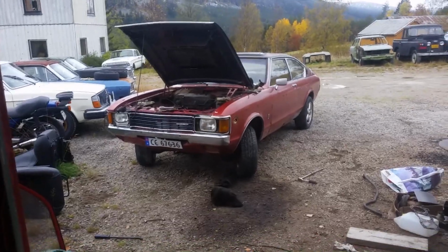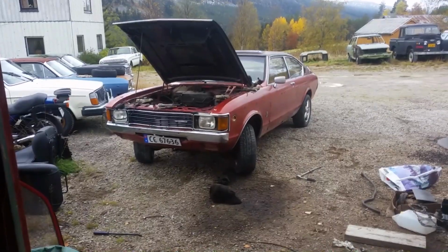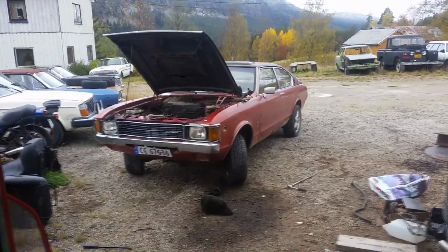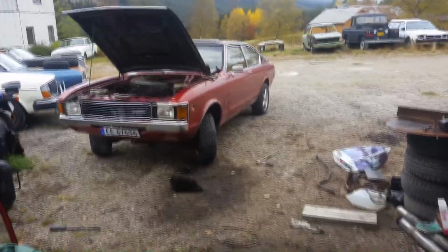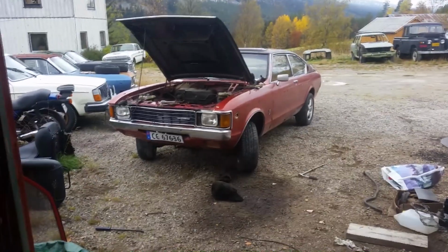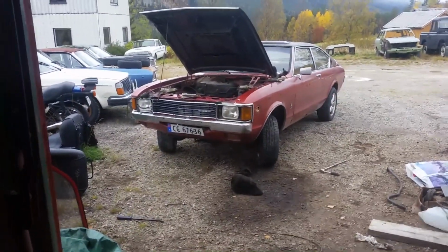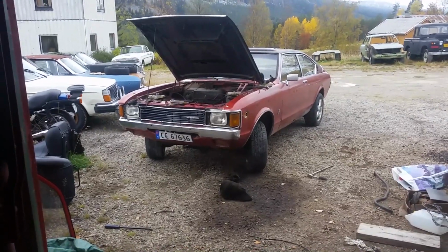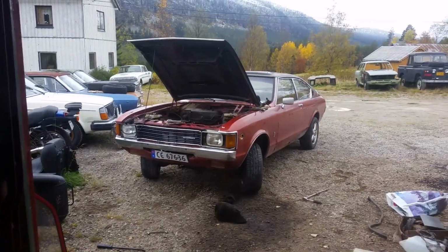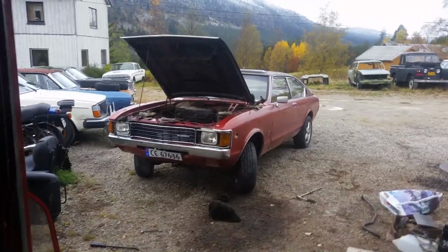The engine that's in there now is coming out. I still have to take off the clutch cable and the engine mounts, then the hood. Then it's coming out because it's not stuck on anything anymore. I mean, the heads are in the garage here after having sent them to get skimmed. So they're in here. Of course, the intake and all the other stuff are in here too. So now I'm just going to pull that engine out and get to work on it. I figured out it's easier to do the oil pan with the engine out of the car. The crossmember on that thing is enormous and it's covering most of the oil pan. So, like I said, that thing's coming out.